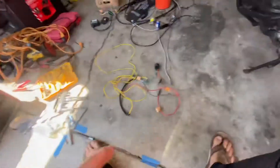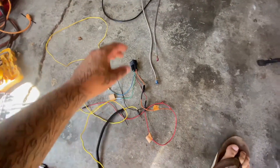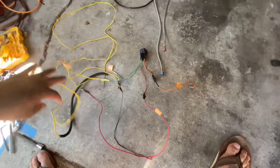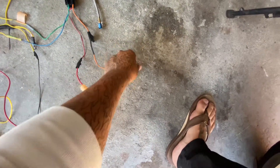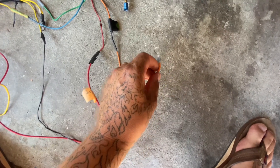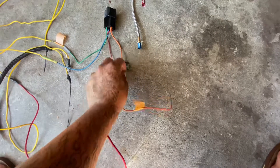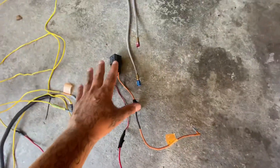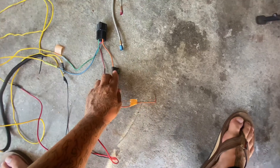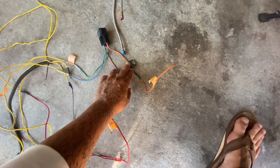After you get the parts and have your nitrous kit, how do you wire it? I did my research and reached out to people, and basically the safest way to run nitrous in my opinion is to have a relay and have inline fuses. This goes right to my power distribution block — gets power straight from the power box, runs through this wire, through this inline fuse, powers the relay. Anything goes wrong with that system, the fuse pops here and it doesn't ruin everything else. Simple but so effective — run an inline fuse on your systems.